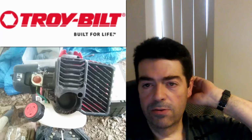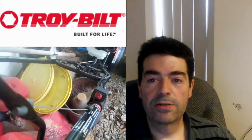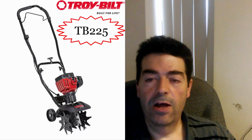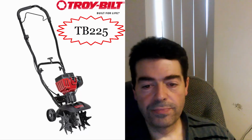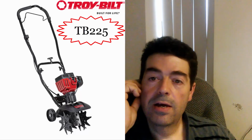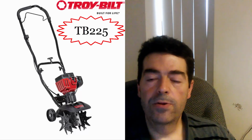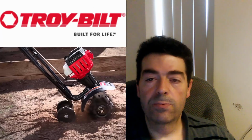The throttle settings on the front of it took me a while to figure out. I don't have a manual for it, so I just played around with it. It has three throttle settings on the front. It looks like there's a setting for having the gas valve all the way open, halfway closed, and then fully closed to shut the unit off. At least that's what I seemed to experience with it. There's not really a choke setting on it. I just fiddled around with the settings to get where it would run the best when the throttle was wide open.